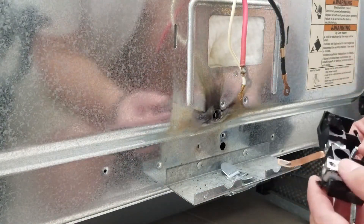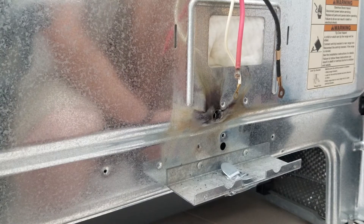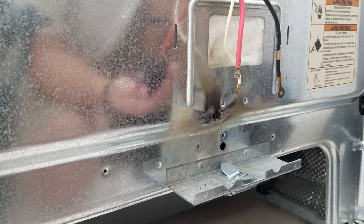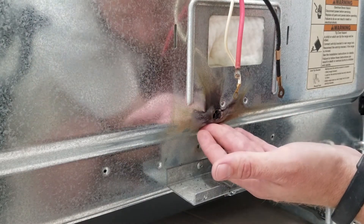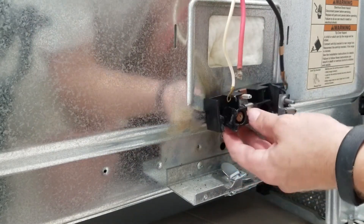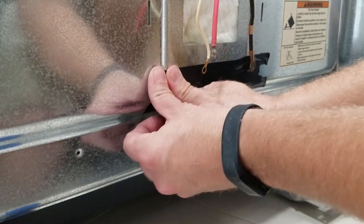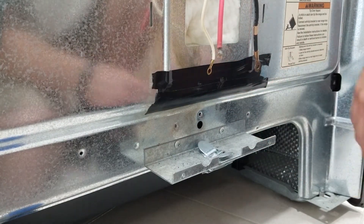The plastic is so melted on one side I have to work carefully to get the screw out since I'll need to reuse it. I also notice a little hole burned through the panel — I'm guessing when the plastic started to melt on the terminal block, it arced against the grounded case, just like a welder. I added a couple pieces of electrical tape to make myself feel better, but I checked the oven from the front and it's fine — no burn-through beyond this back panel.